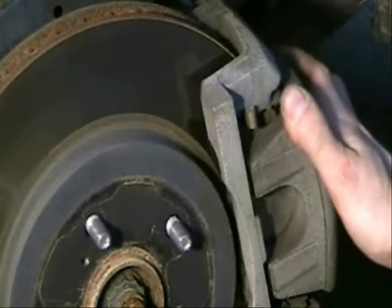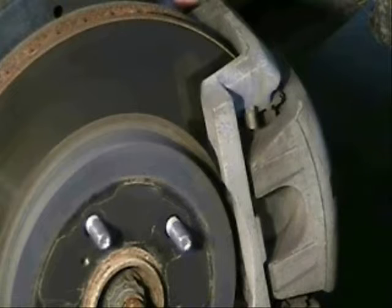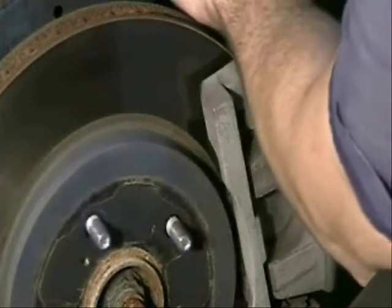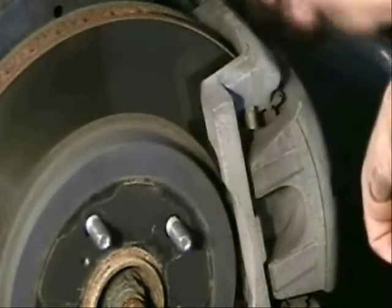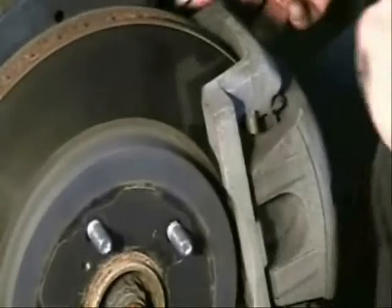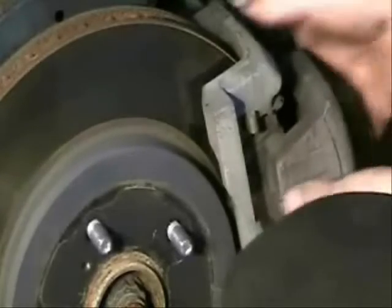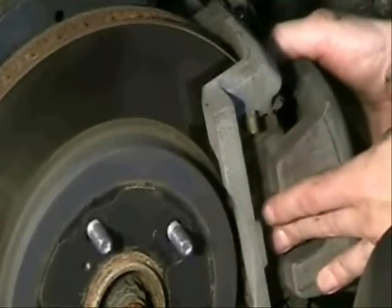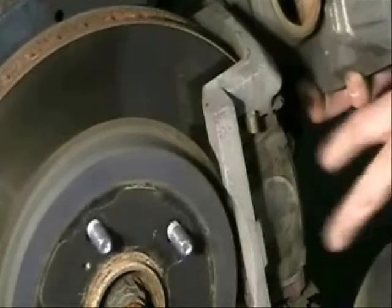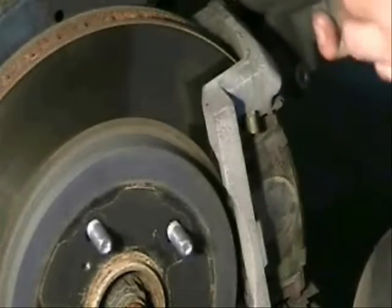Here is your brake caliper, and this is the caliper bracket that the caliper bolts to. There will usually be two bolts on most models. They're usually not on too much torque, but they're weathered a little bit, so it helps to hit the ratchet to break them loose so you don't strip them. Once you get those bolts out, you should just be able to wiggle the caliper loose. Take it off slow because different models have different ways of retaining the brake pads — some models may have clips or springs — so pay attention to how your model is put together.